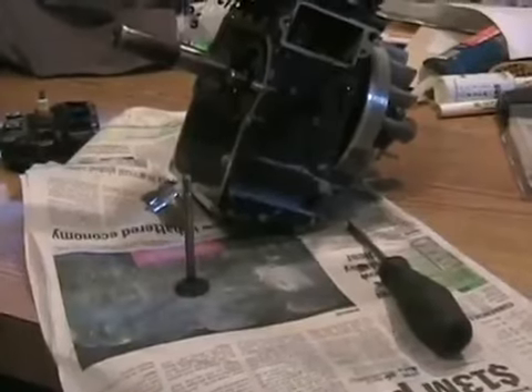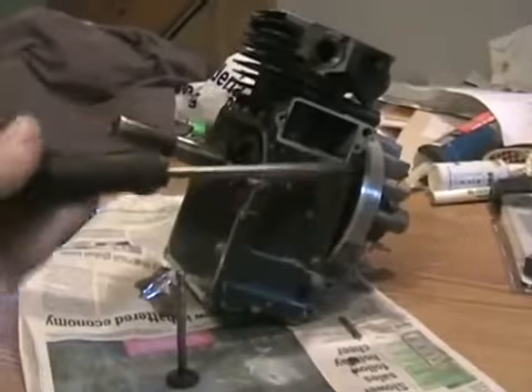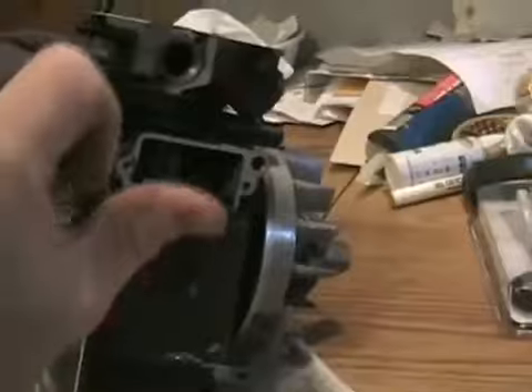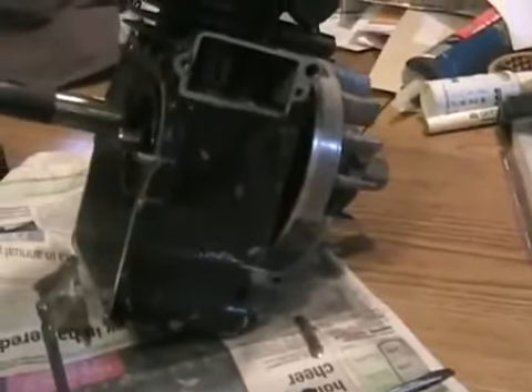You just set the bottom crank to TDC. Once you've got your engine all apart, the only tool you'll need to fix bent valves is a screwdriver — you don't need a valve removal tool or anything else, just leave it all in place. You may just need something to pry on your valve. Sometimes I put a big socket on the head, or a big spark plug socket on the valve spring and push that down, and that will open and close the valve so I can look at it to see if it's moving sideways or not. Very simple, but very effective.